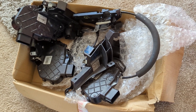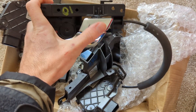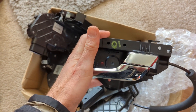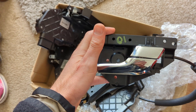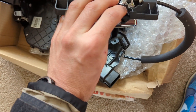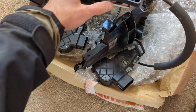This is my box of all my old stuff. I actually bought these handles because I thought it was the actual handles that were the problem first time around — so I've now got some spare handles if anyone wants them, you can probably have them for free. The issue was the car would chirp two beeps after it locked, and when you went back to it with a key it would still open the door and the alarm would go off — so it wasn't locking. On the back side here you can see where that cable goes in — there's also this white bracket or white part of the cable. Just clicking that white part into the handle on the inside of the door card — that's it. Now it all works exactly as it should do.